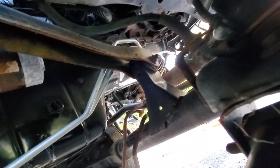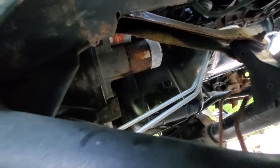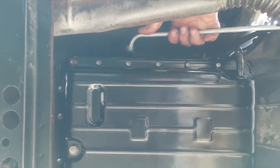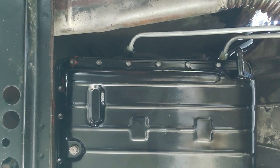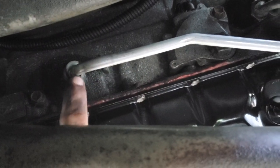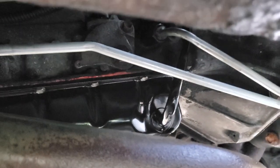These trans lines go up and over just about everything, so I threw them over the axle and over all the steering components. Now I lined it up right next to the oil pan and up next to the transmission. Got the return line right about here - hard to see the hole but it's just about lined up where it needs to go. Slid that in place, and you can also slide this one in place - just push these in when we're ready. Got both lines in. You want to push them in nice and straight and make sure these clips expand out so it locks into place.